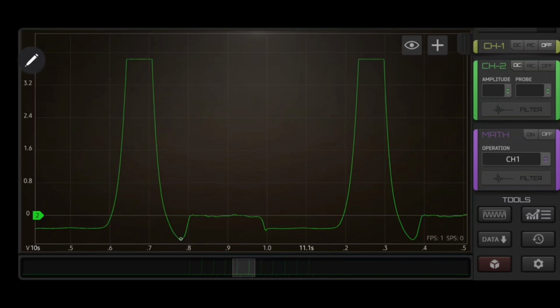But that point of change there, you can see, is the point I was talking about in the idling waveform, where you want that timing to be somewhere between like 30-40 degrees or so before that bottom dead center line. So that's what you'll see. Obviously it should kind of match, you should have that little point at the bottom, but one shouldn't come down sweeping and the other rise straight up again. They should be somewhat similar, the same shape. So there's definitely some issues in timing on this engine.